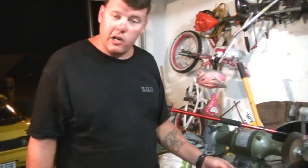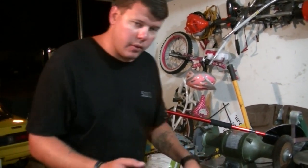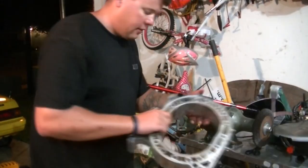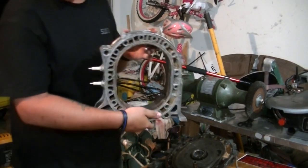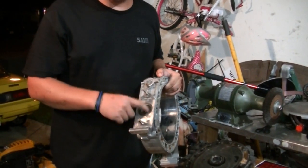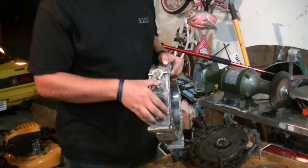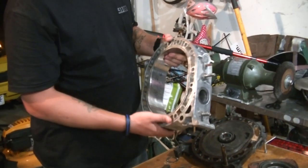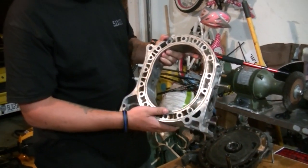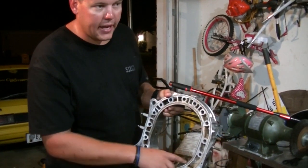So, lack of valves: the rotor not only acts as a piston inside the rotary engine, but it also acts as your valve system, controlling intake and exhaust. So simply what I'm going to do is take the rotor housing here. The rotor travels inside this housing. You will notice this has a peripheral exhaust port. Basically, this is your exit where your exhaust manifold and flange would bolt up. And this is basically where your air would exit from.